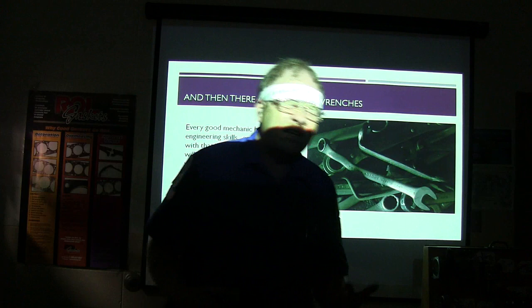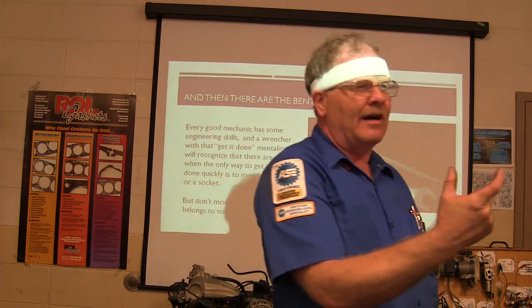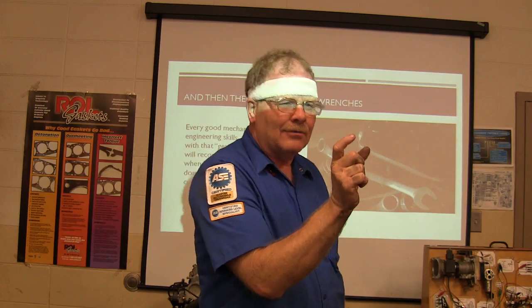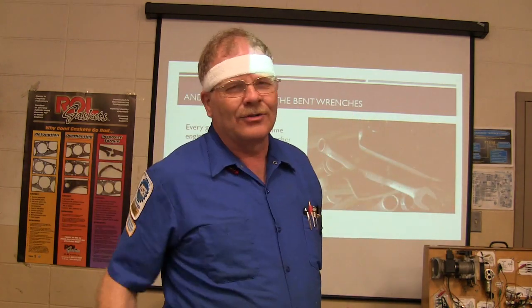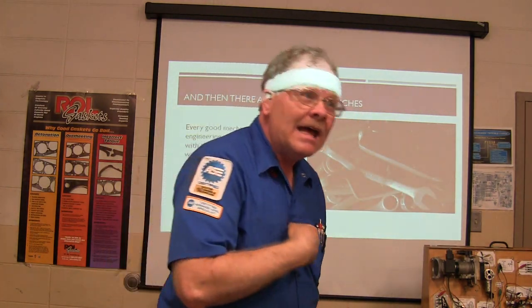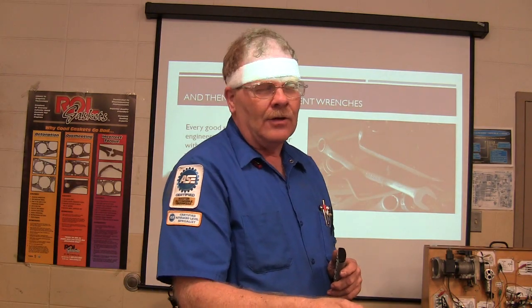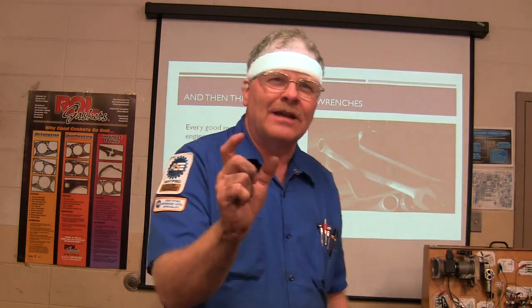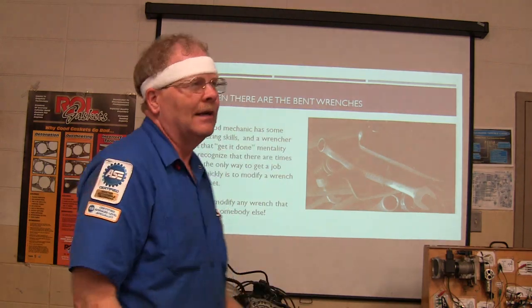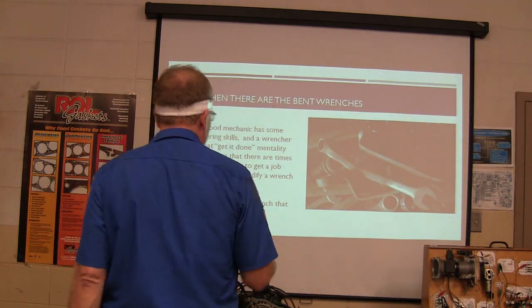It's a good idea to have some cheap Chinese wrenches in your toolbox so you don't mind cutting them up. You know how aggravating it is to get oxygen sensors out of some of those 5.4s because it's sticking up the wrong way and you can't get anything on it? I got a 7/8 wrench, cut it off about that long, put a little notch on either side of where I cut it off, put it up there, get a pry bar on it, break it loose, and then screw it on down. What happened to me was, when I was getting ready to leave and come teach, I had to do one of those right at the very end, and some knucklehead came along and stole my little wrench — they knew what I was using it for. Having a special tool like that, that they don't offer on the tool truck, sometimes you can copy one with your own ingenuity.